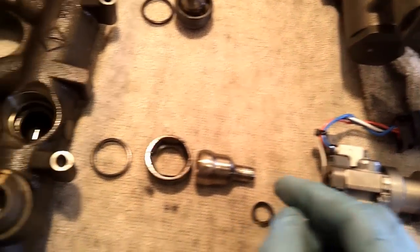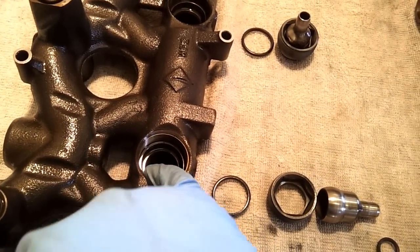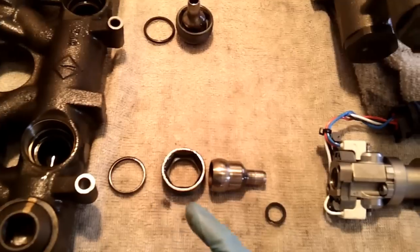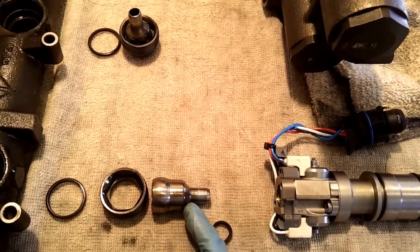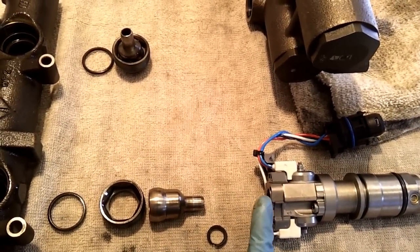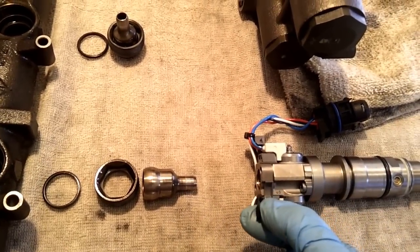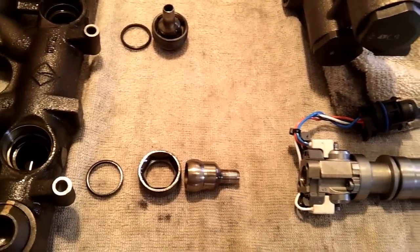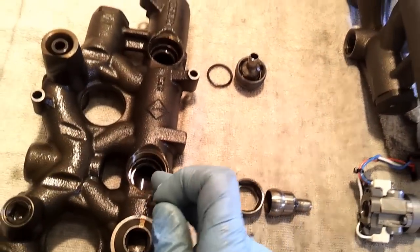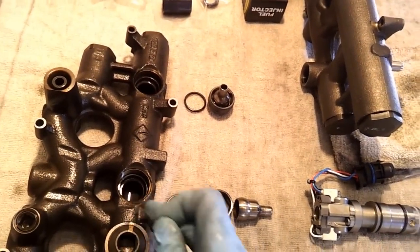What's happening is you've got your high-pressure, low-volume oil leak there, shooting out at like 3,500 psi, traveling along the body of the nipple cup, and just eating away at the top of that seal until eventually you get a failed seal. So if you've got a seal that's failed from the top down, you know for sure that you need to replace that O-ring.